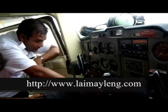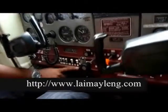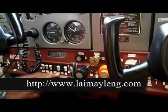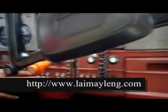And this is all your exterior lights. Exterior lights are all down here. Alright, taxi lights, landing lights, strobe lights, nav lights, beacon lights, okay, are all down here. Alright, and these are all your circuit breakers here. Make sure all your circuit breakers are in.